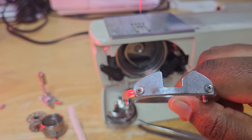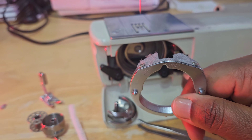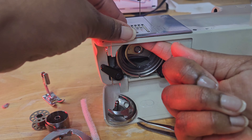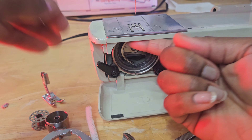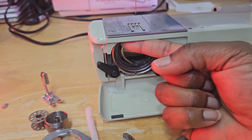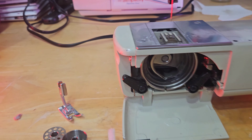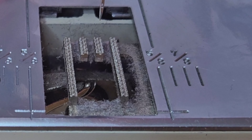You can see all the dust that accumulates in that area. I'm also going to pop my needle plate off. There's a little black knob right here — if you slide your hand across the front of this you should feel something jagged right here. Push that and the plate pops off. Now if we look into my machine you can see all that dust in there.